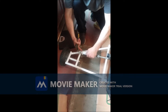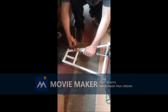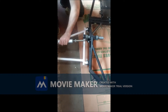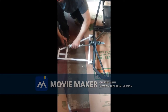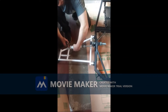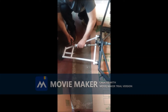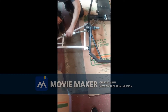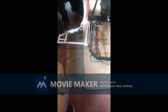This spins and it's lowering. As long as this nut is not spinning, it'll go up and down. Do you see the height going up? You getting that on camera? And that's how you set the axle height.